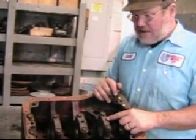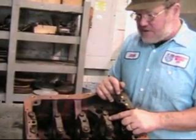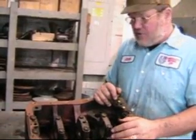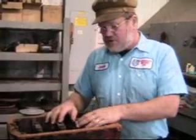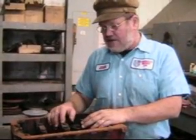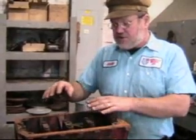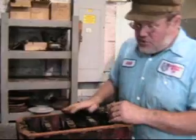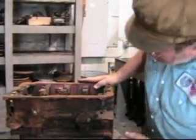When you've got 90,000 miles on the car and you want to get another 50, 60,000 miles on it, if you don't do anything, you can only get up to about 125,000 usually before you start to pick up a rod knocker, such severe wear that you can't retrieve the engine. You have to take the crank out and have a whole lot of work done. But if you do change the oil pump guts, change the 4 rod bearings, the 3 center mains, put in a new oil pressure relief valve and spring back here, where'd it go?